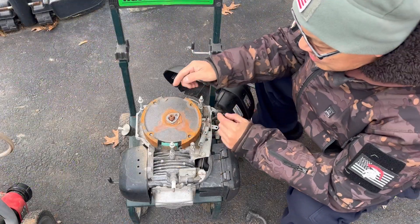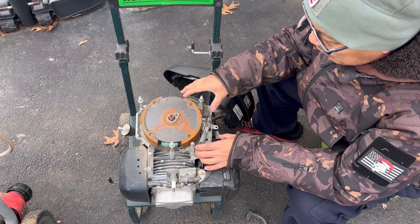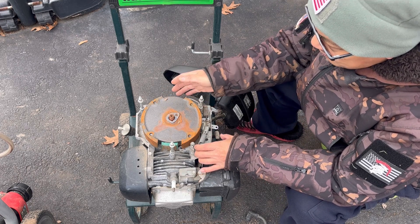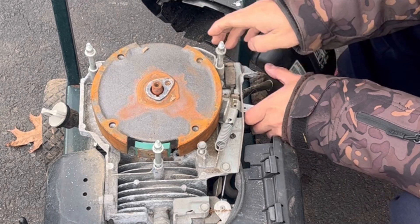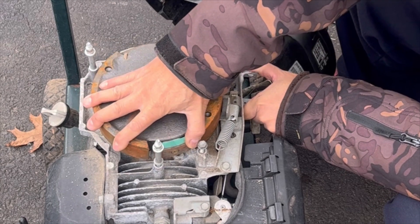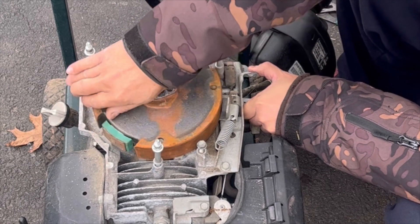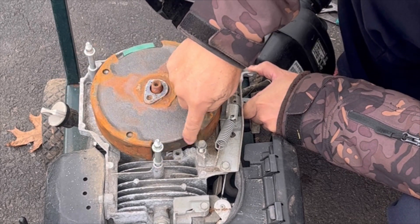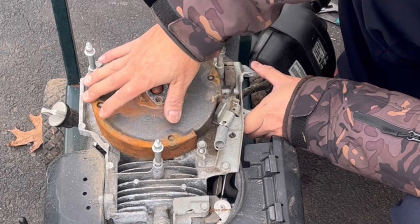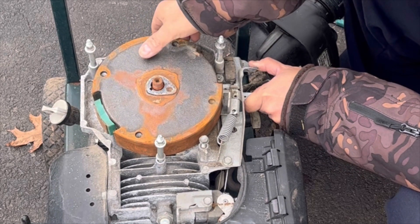Check this out: I put the woodruff key in and it fit really well, but when I put the flywheel on it doesn't look like it seats properly - it needs to go down more but it doesn't because it's a larger size. Also, look at the way the flywheel is shaped: this one has a brake mechanism. If this is spinning and you stop it in certain positions, it'll get caught and jam. You'd never be able to get it out again - it would jar and break things. So it's apparent this flywheel will not fit.